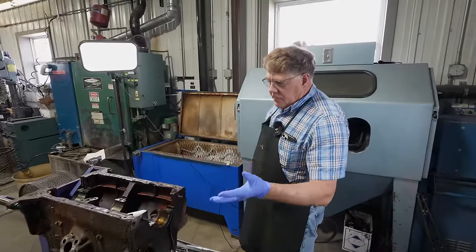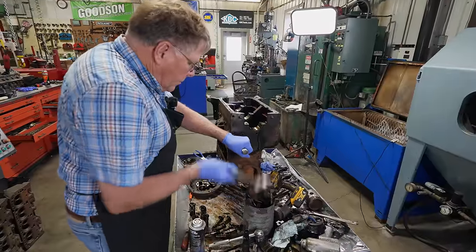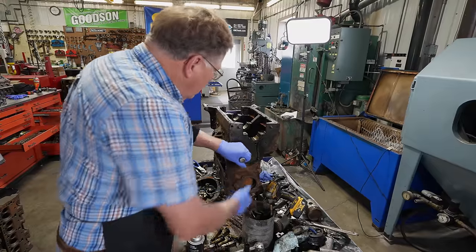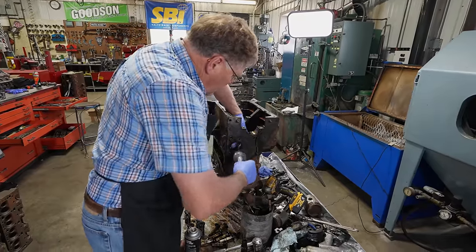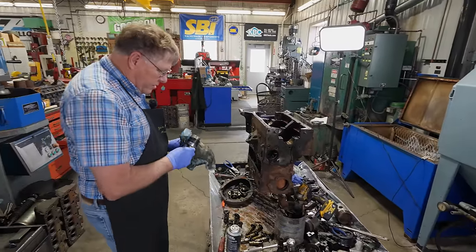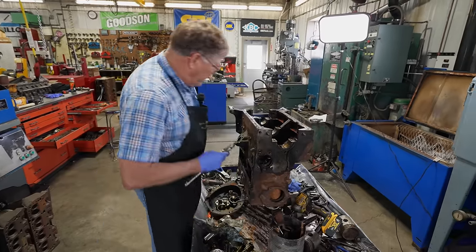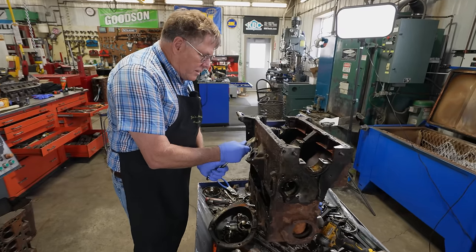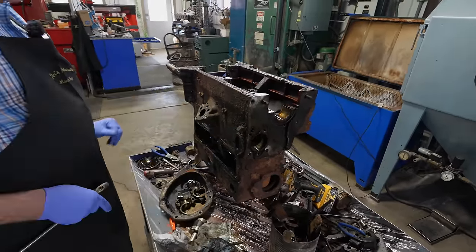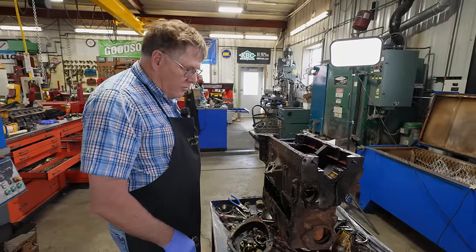Alright, so we've got this thing pretty well down. Maybe I'll get the tool and knock that cam bearing out. Okay, there the cam bearing is out. Like I said, there's no other cam bearings in there — the rest of it rides metal on metal. As far as the block goes here, I'll go back through. There's quite a number of gallery plugs on here that I'll have to get out. Alongside here we've got a couple of fittings I need to take out. We'll knock the freeze plugs out of it, and this will be ready to go into the oven and be baked with the other parts so we can get it cleaned.